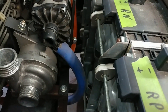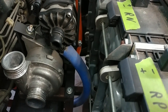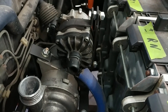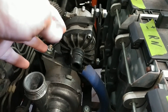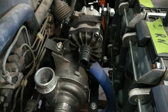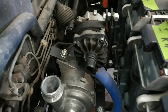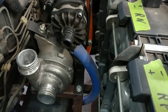You can see the blue tubing connected to the small pump, and that goes under the car and into the battery charger slash DC-DC converter. One important discovery was that the volute of the pump can be rotated — all these holes and stuff are symmetrical. So if you just undo the screws and gently pry off that plastic part, you can clock it in 90-degree increments, so the connector sits in a good spot with the output facing down like that.